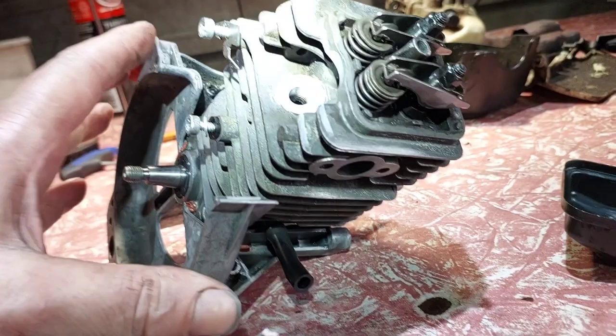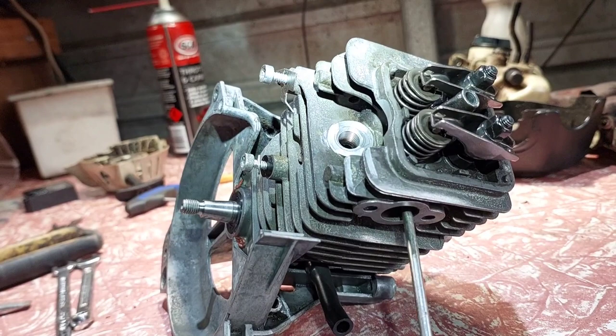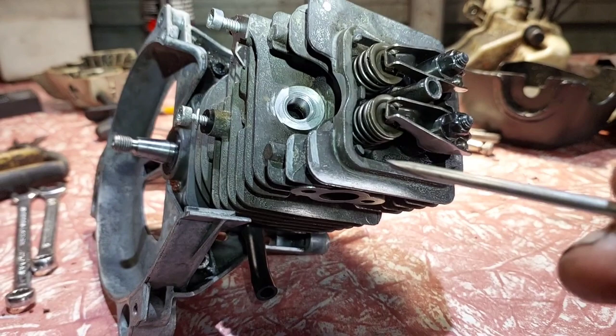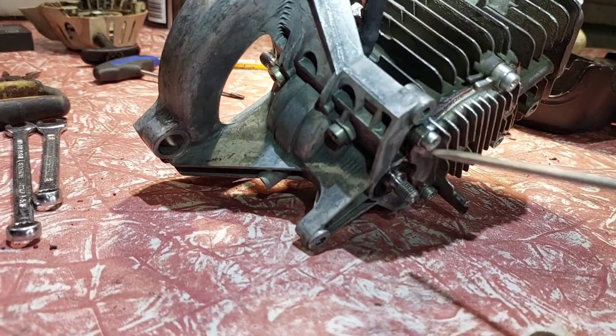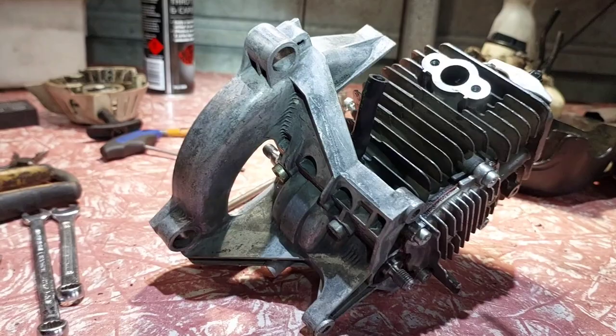I've finally worked this thing out — it's quite simple. There's the inlet just there where fuel and air goes in. In the intake there's actually a hole — the top is here and it goes into the intake port. As that fuel gets in, it will lubricate the valves because the valves are exposed to the fuel vapour, and that vapour will then drain back down these pushrod holes. Once it's gone down there it'll lubricate the bottom of the crank, and the carb sucks the excess up through this pulse line. So this pulse line acts as a pulse signal and also a fuel scavenger, starting the whole circuit over again.